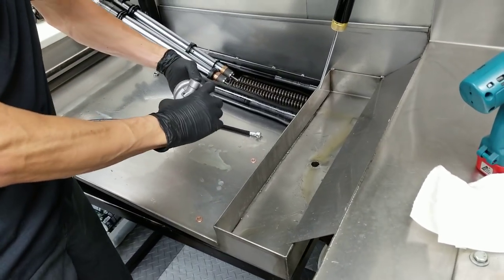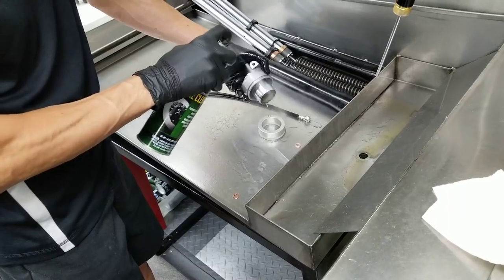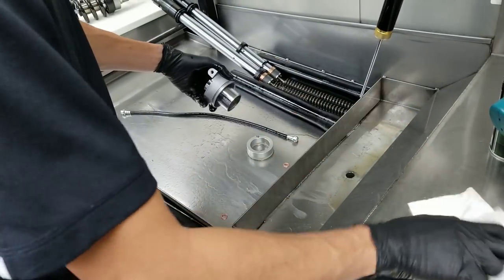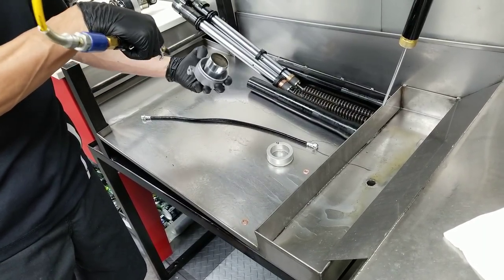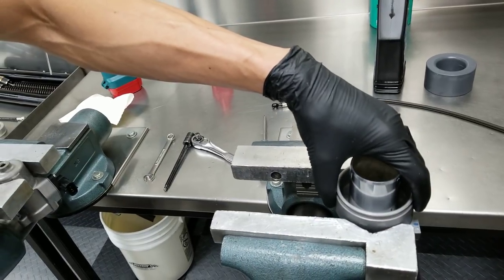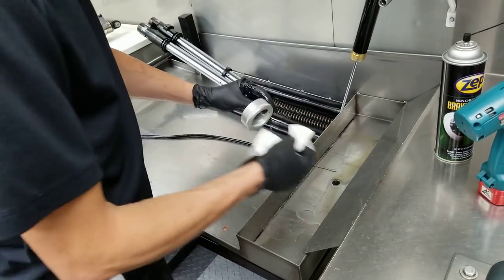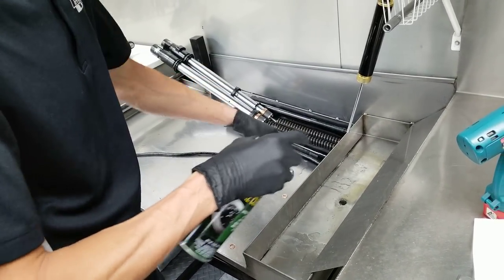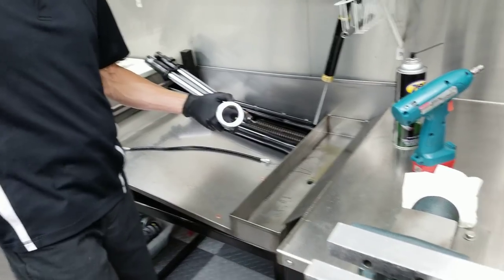So there we use just a little rubber tip on any little common compressor. It could be anything, a little pancake. We don't need any fancy form of it, just a little basic air pressure to pop the cylinder out. Usually it would be a lot dirtier. This is a brand new unit. So this unit's off of a 2018 Honda Goldwing, so the condition of it is basically brand new.